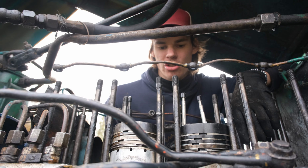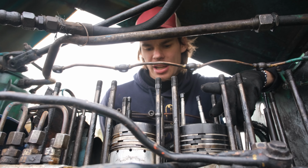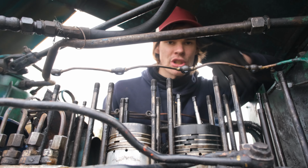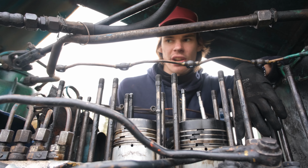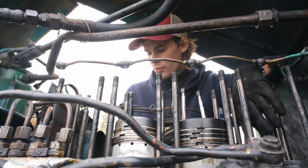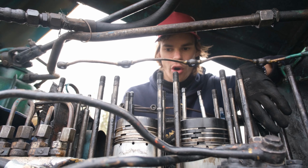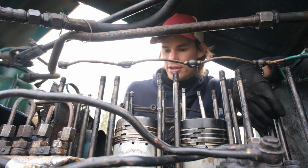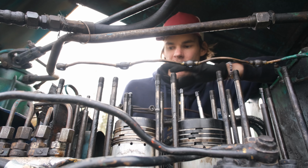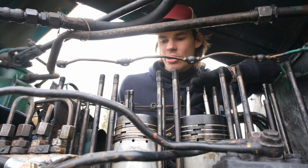We are gonna try to solve this. Probably it was kind of lack of compression. If all of them also go together, I'm not sure if that causes lack of compression, if the compression escapes into the cylinder. I remember there was actually smoke coming through the pipe off the bottom, which is kind of like an overflow for oil. It was coming through there, so maybe that's what was causing also no compression in the cylinder and good compression in the rest. This could be our core problem.